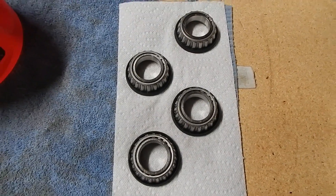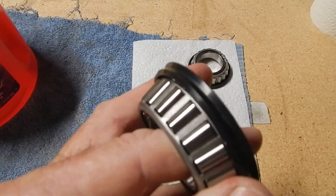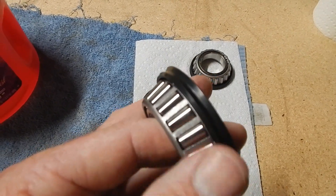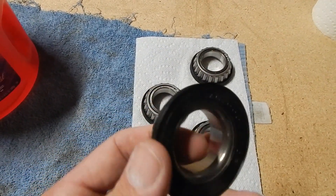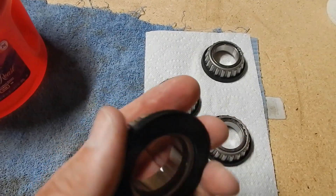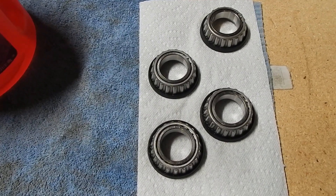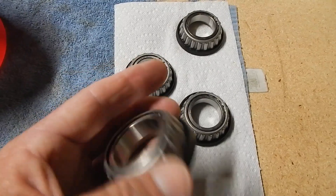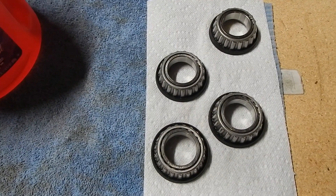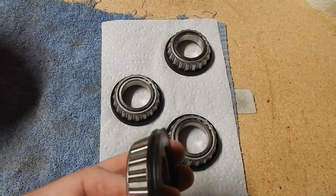The first step in packing the bearings is to get them cleaned up. There's a little bit of oil residue on them when you get them. I've read that if you pack them without cleaning, that oil residue thins out the bearing packing and diminishes its longevity and effectiveness. I cleaned mine in some gasoline and dried them really well. I've heard others use kerosene, which is okay. I saw someone use brake cleaner, but I read a comment that it's too aggressive on the rubber parts of the bearings. A lot of builders use gasoline to clean up bearings. They're ready for packing now.